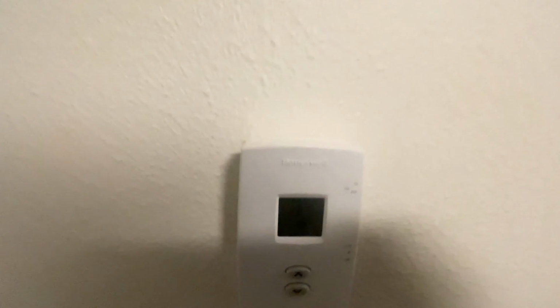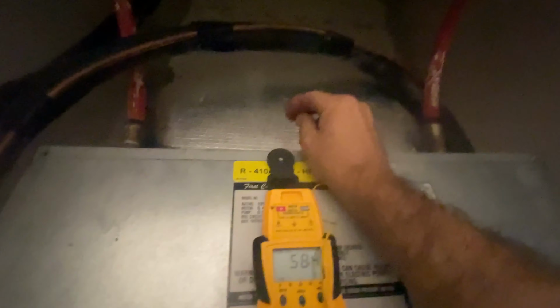It's dropped a degree. We're at 77 now. Almost a 20 degree split. I'm happy with that. I'm not gonna go on the roof and gauge up, especially since it's like 50 degrees out and raining right now. I'm gonna call this one good. Lunchtime.